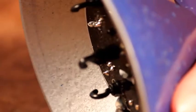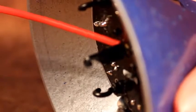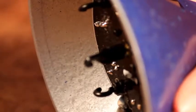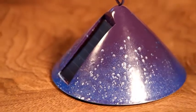So what we're going to do is get a can of WD-40 and give this hook a little bit of love. We're going to aim the oil right at the base of that pin in the center hook and give it a good spit. And then you're going to take the hook in your fingers and spin it one time around clockwise, spin it one time around counterclockwise, and then just give it a rest. Set your top down for about half an hour, and then come back to it and we will find out if it's working.